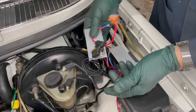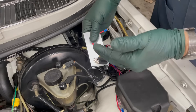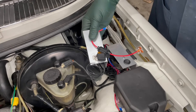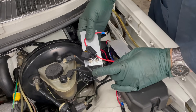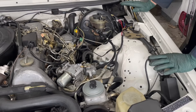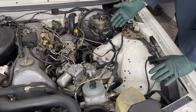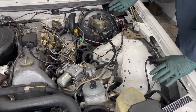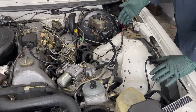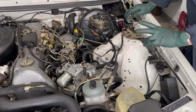I'm also considering offering this kit with two switches and a keyed power source, along with two relays. You'll be able to use that when you want to power two things like a boost pump and a boost heater if you're running waste vegetable oil. Everything else is the same - you'll just have one extra switch and relay to connect. This is the W123, but you can put it in the W115, W116, and W126 - it's just that this prefabrication won't fit; you'd have to cut wires and change hose routing.